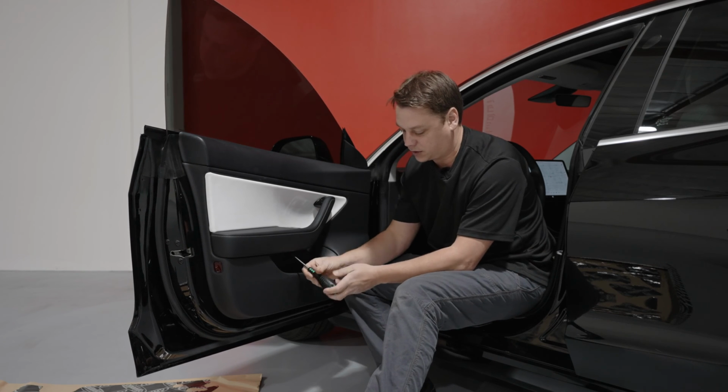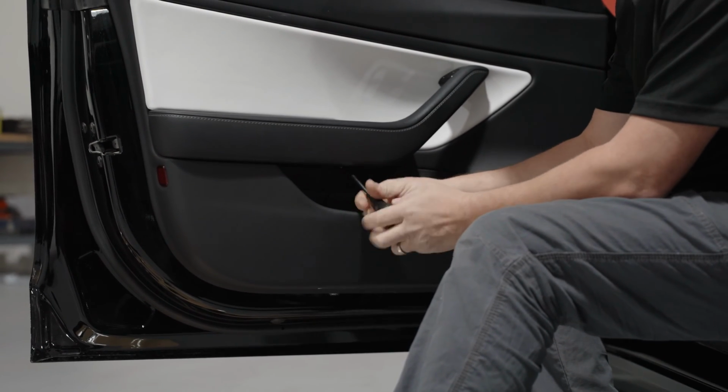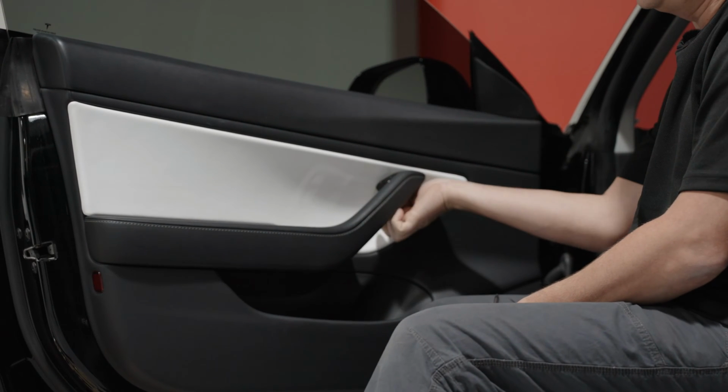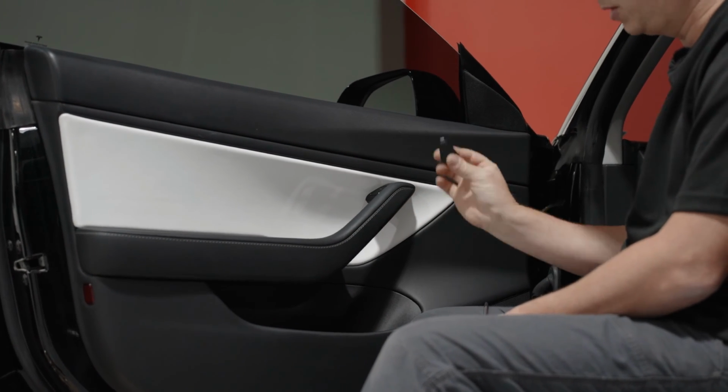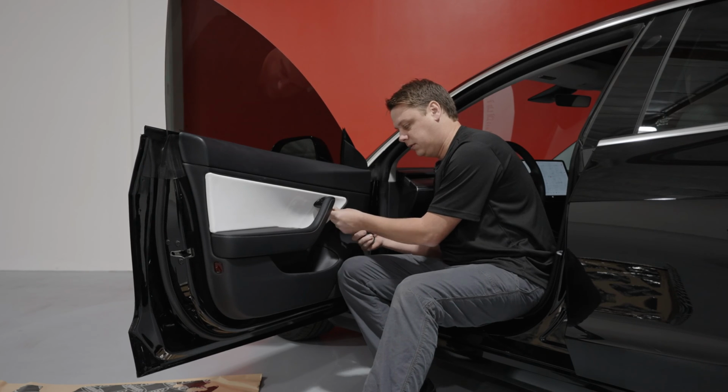So for this, we're going to start off with the Torx 30, so a TX 30, and you take out the bolts like this. There's the one under here, you can get your fingernail underneath it and pull the plastic trim off, and then get your screwdriver in.